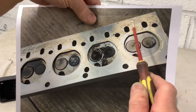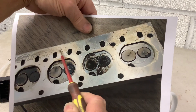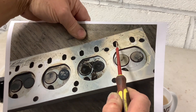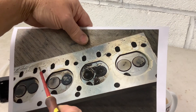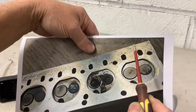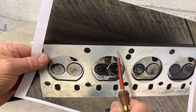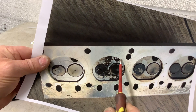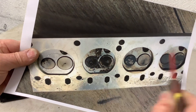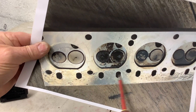What gets me is these are where the pushrods go through. Now on the back of these oval holes, where the pushrods go through, the pushrods are actually hitting — there's a burr been raised on here. They are actually hitting the cylinder edge. How can you have an engine that costs that much money and not have this sort of thing sorted out? And where the spark plugs come through and you screw them in, it raises up a burr here. Each one has got a burr, and if you put a straight edge on it you can see daylight underneath each one. These little nicks are where the pushrods have been rubbing on them.